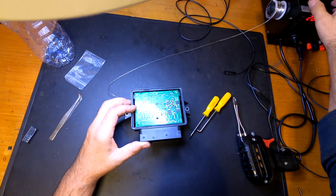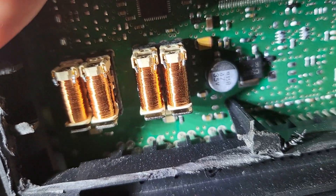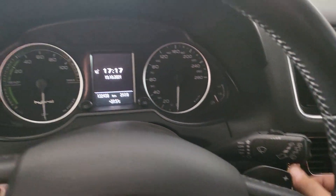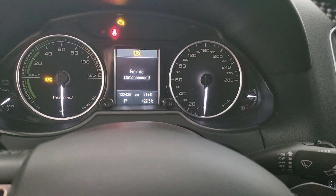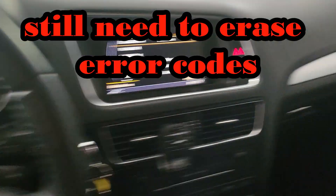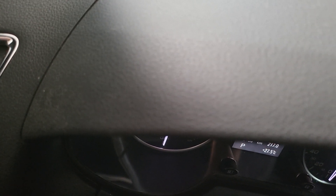When you plug this module into the car, the car diagnoses itself — as you can see, both relays click, which is a good sign that it recognizes both motors for both rear wheel brakes. The warning lights were already gone as soon as I cycled the electronic parking brake, but there was still a warning on the center display. I remembered I still needed to erase the codes and perform the basic settings, since I hadn't disconnected the battery before removing the module.